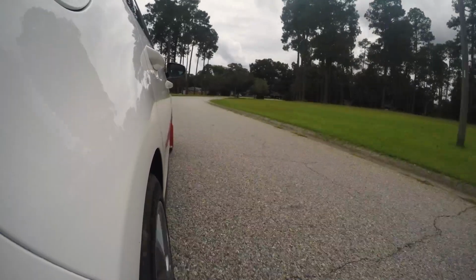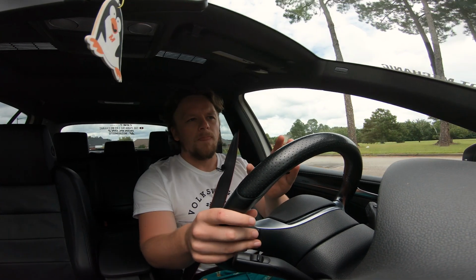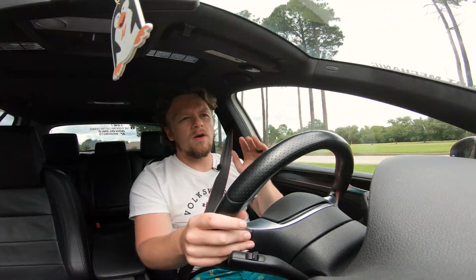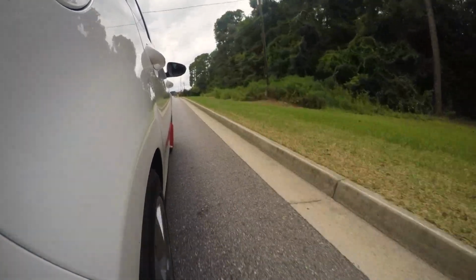The reason they upgrade the rear is because in a front wheel drive car, a lot of the weight is at the front. So when you're turning in, you're pushing a lot of weight forward into the ground and you're actually lifting the inner rear wheel off the ground sometimes if you turn in very sharp. It's called doglegging, tripoding, whatever you want to call it.